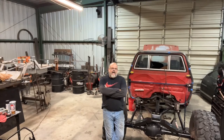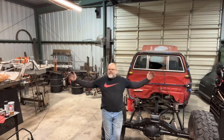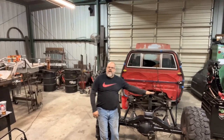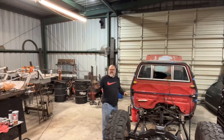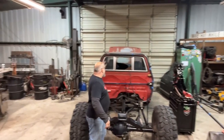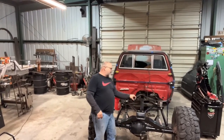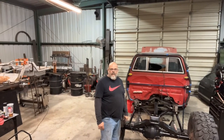What's up YouTube and welcome back to the channel. As you can see, we've got the Yoder back out. It's still sitting where it is because you can't drive it — no shocks, no springs, no nothing. I have a pair of Fox shocks, about 40 inches long, 24 inches compressed. They're going to sit here, and as you can see we've already got one tube bent. We're going to wrap the tube around here, come across there, bring a couple of tubes down to meet it, triangulate it — tubes everywhere. We're going to bend some tube.